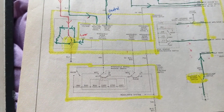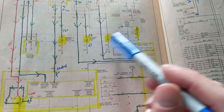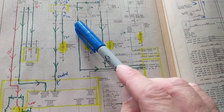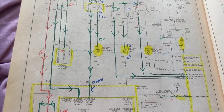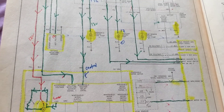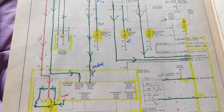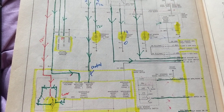This is the control line for the front wiper motor, this is for the rear, and the headlamp washer pump control line is this one. When you close the headlamp switch, it detects it, closes the relay, and the headlamp washer pump is activated. I'm also going to do a video about shorts, especially in series circuits, since I've gotten quite a few comments about that. I'll go over the multi-function switch in a separate video as well. Thanks for watching.